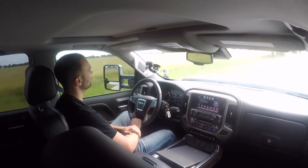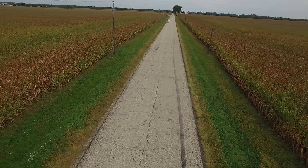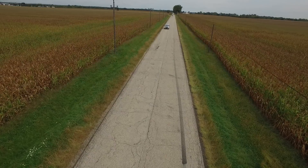It doesn't mean that the emission system is going to tolerate it long-term. We really need to see what our relationship with that system looks like — see how much capacity it has, see how well the turbocharger controls the air-fuel ratio, and see if we need to upgrade the turbocharger.